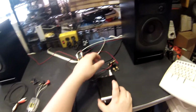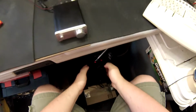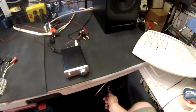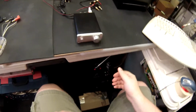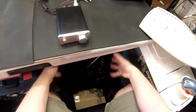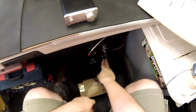If you have those set up on a small amp like this that doesn't have a dedicated sub out, using these inputs, at least on this particular subwoofer, doesn't work. It works, but even cranked to maximum, because the amplifier is only up 20%, producing good volume, that's not enough power to make the speaker level inputs do their thing and make this subwoofer blend. So, to get around that failing, you have to use the line level inputs.